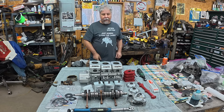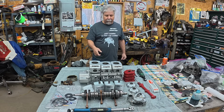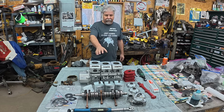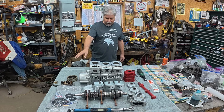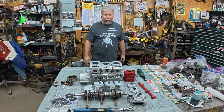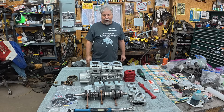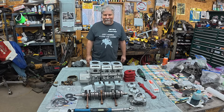Oh yeah, first I did recondition the cylinders, meaning I gave them a dingle ball hone with the correct dingle ball, and had Chet, of course, at Minnesota Motorsports, vapor hone the whole motor, so that's why it's so clean. So let me show you that ball hone process on the cylinders, and then let's get measuring.